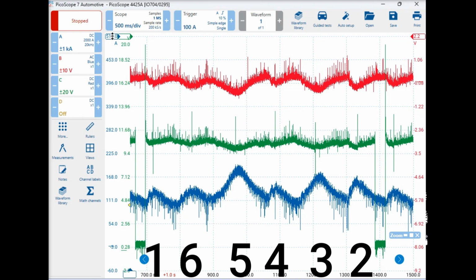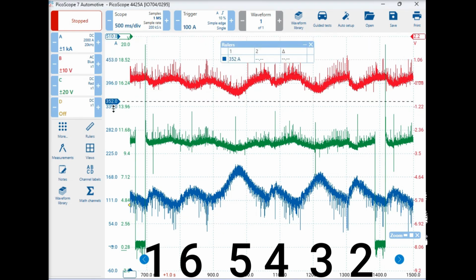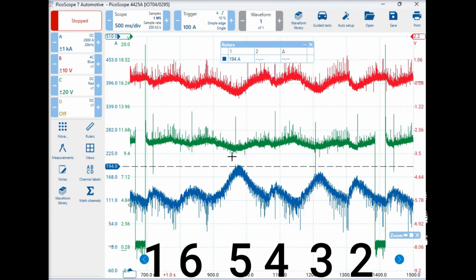Let's just drag this down, and we'll have a look at the top of the peaks there. And clearly this guy over here is the best. So this was number 1. What was next? 6, so that'd be number 5. 6, 5. 5 cylinder is good. And what other cylinders do you reckon would be okay-ish? 3 would be pretty good. Okay, so then there was 4, 3 and 2, wasn't it? Okay. 5, 3 and 2, sort of a bit higher than the rest.